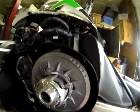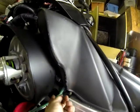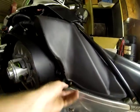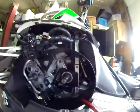So if all that has happened, then you're ready to start drilling. We're going to start first and drill a 1/4 inch hole in this upright support and use the included bolt, and then we're going to figure out where these 2 holes are in the chassis and drill those 2 holes in the guard and rivet those on, and then we'll rivet these on, tighten this bolt, and we're pretty close to being done.